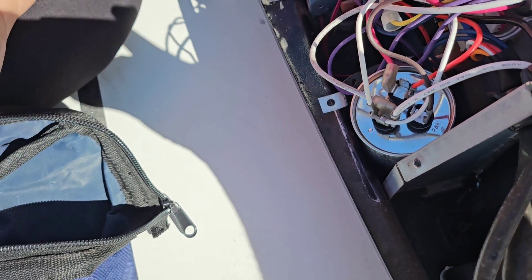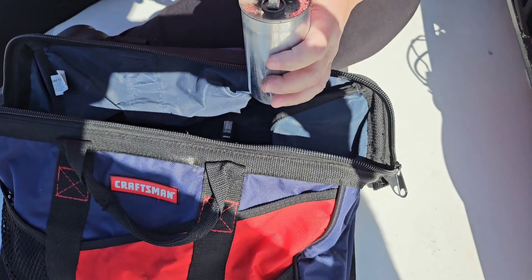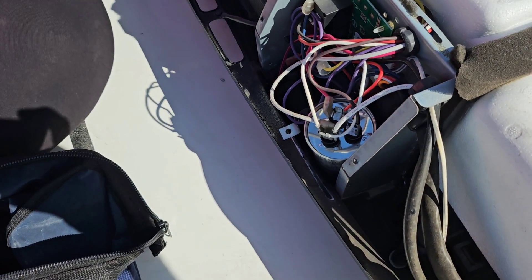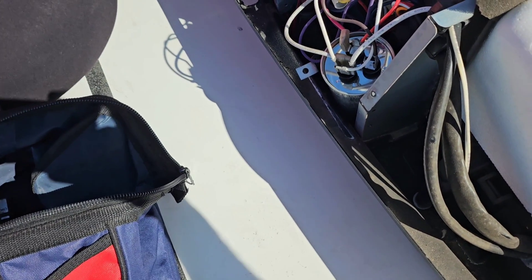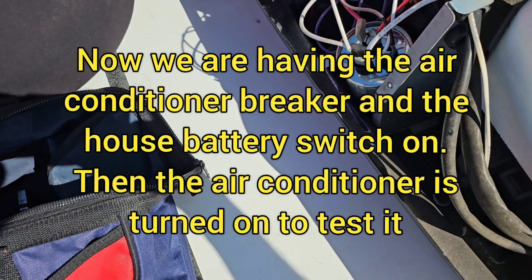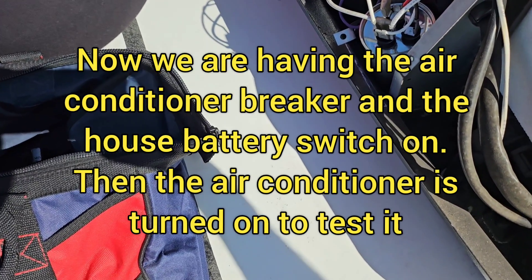Now I'm just going across because there's built-up energy in here, so you just try to short it — discharge it — so if you were to touch it you wouldn't hurt yourself. Okay, so now this is the moment of truth. Donna, turn the breaker back on and the coach switch back on and let's see if the air conditioner works. Turn it 90 degrees to the right from off to on, and then flip the breaker on after that.